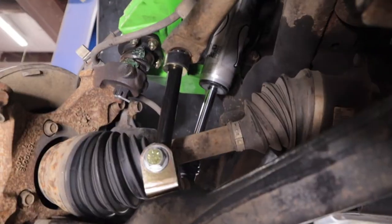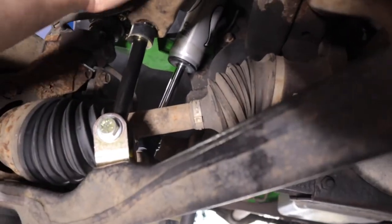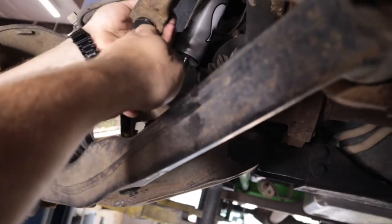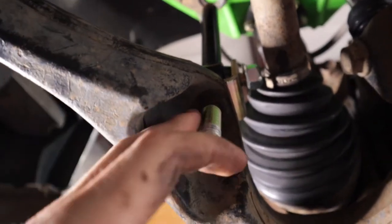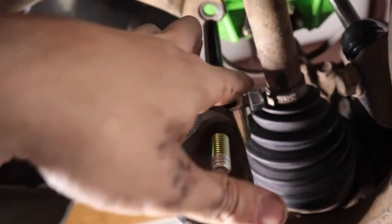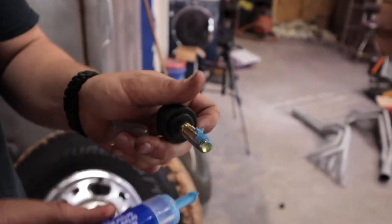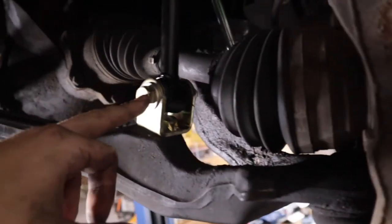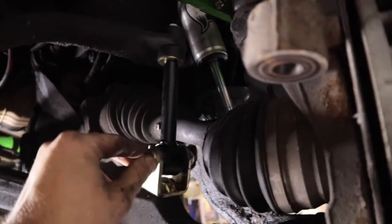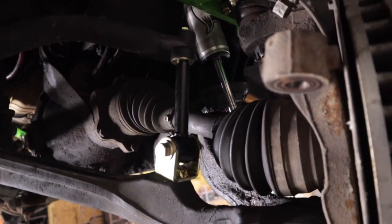Now that the pitman arm is out, we can finish reassembling everything. Here's the clevis — we have it built with a bushing at the bottom. The two gold washers Kryptonite supplies go at the bottom and the top, and there's a washer at the very bottom as well. The bottom bolt gets torqued down to 70 foot-pounds with some blue Loctite added. The linkage bottom bolt to the clevis is 70 foot-pounds, the bolt I'm pointing to is 60 foot-pounds, and the bottom bolt uses a 15/16-inch deep socket.